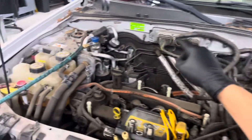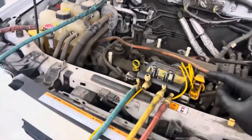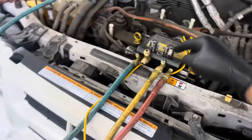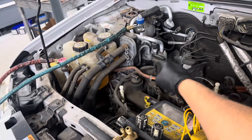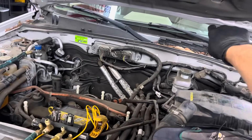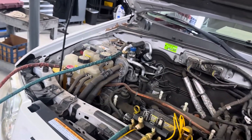That 650 grams was recovered with the key off, engine off, and refrigerant trapped in the other half of the system. This was filled yesterday with 1080 grams, so all the rest of that refrigerant is trapped on the liquid side — in the receiver dryer and in the liquid line. As soon as I turn the key on, that valve is going to open and release the rest of the refrigerant.